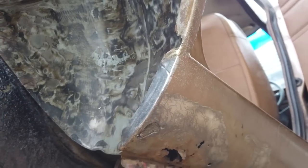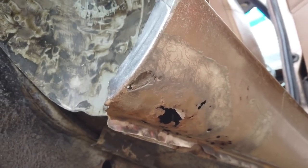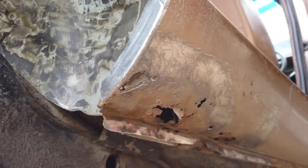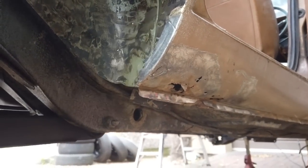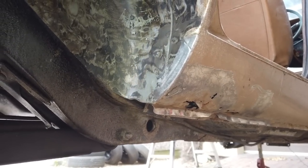We're going to get the spot weld drill bit. I don't know which bit to do first. I think I'd like to do, well, I normally go from front to back, so really should do this bit first and finish on the back. So I'll do that. Start by slicing the sill out and getting it in. Here we go. So you're going to see some cuts going on. Removal of the old sill, or at least a section of the old sill. Project Pappa then offside underway.